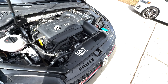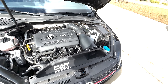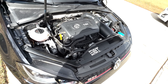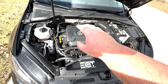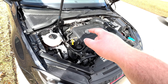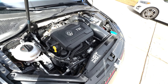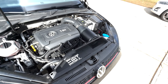If you guys have been following along with the wastegate duty cycle issue, I highly recommend you go watch the older videos to catch up — it would take too long to TL;DR here. We got the Blaze intake installed, you guys saw the virtual dyno chart, and in my last video we talked about hybrid turbos on the MK7 platform. It made 30 more horsepower and we had a 17% decrease in wastegate duty cycle with the Blaze intake.